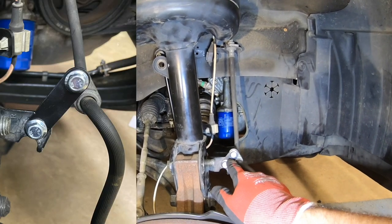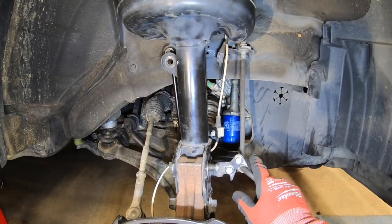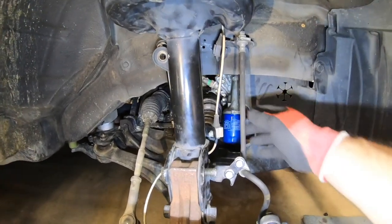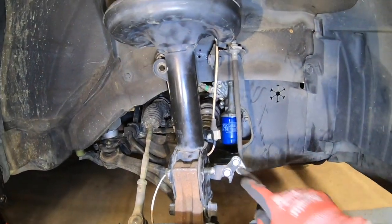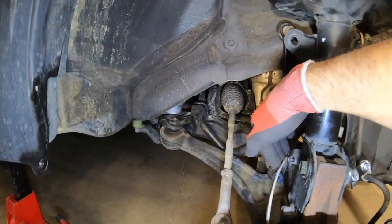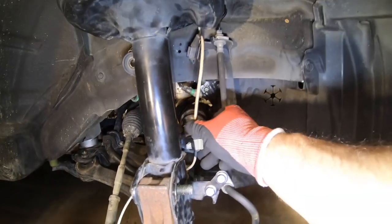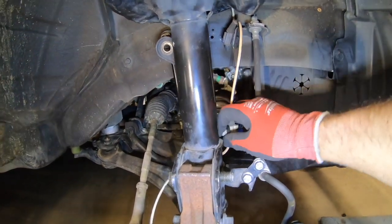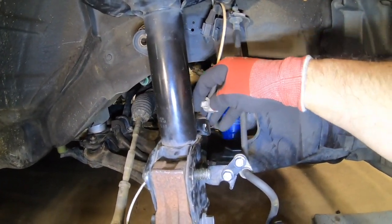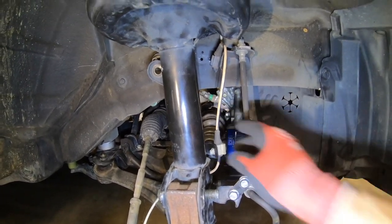Wrapping up this side, we're installing the brake line bracket extensions. The bracket shown is for the two-inch kit; the three-inch kit comes with ones about an inch longer, bringing the brake line up even more. It still has plenty of slack and isn't pinched. As for the ABS lines, just leave them in the factory location — there's plenty of slack built in. If you're really concerned, you can disconnect a clip, bring the wire up, and zip-tie it to a nearby tab for an extra inch of slack.